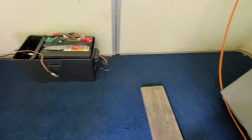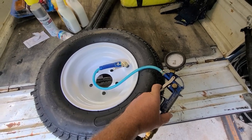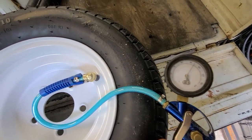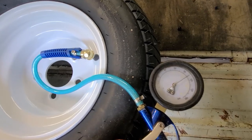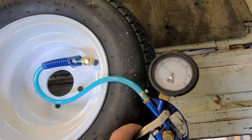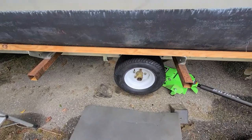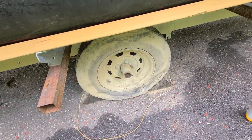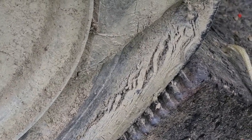Let's see how long it stays clean now. I went with the lower profile tires because that's what they usually use on pontoon boats — makes it easier for launching. Maximum pressure is 50 psi. The tires are 1,100 pounds apiece rated. The boat's 800 pounds with nothing on it. I figure with the motor, furniture, and all that stuff, it's probably 1,500 to 1,600 pounds. Getting the new tires installed, checking the bearings, greasing them up. I think these tires got their mileage — would you trust them going to Florida? I wouldn't.